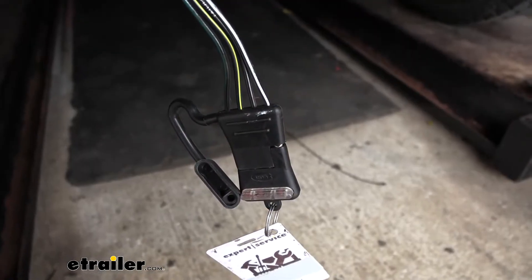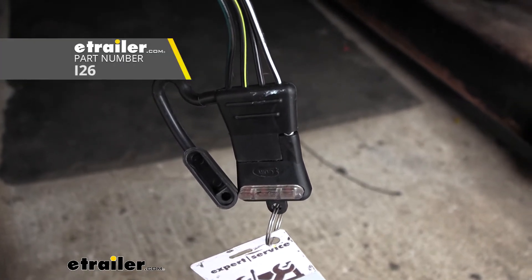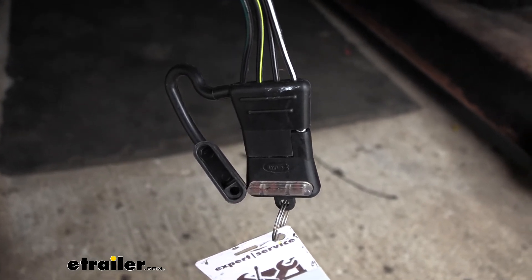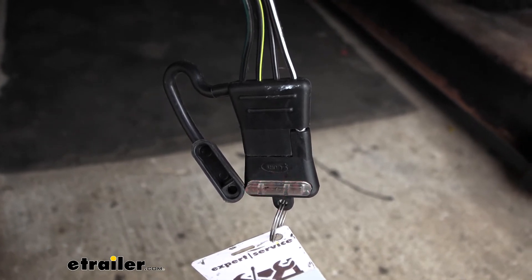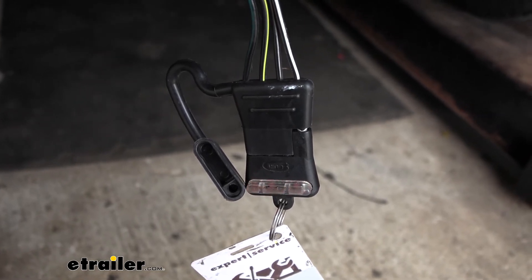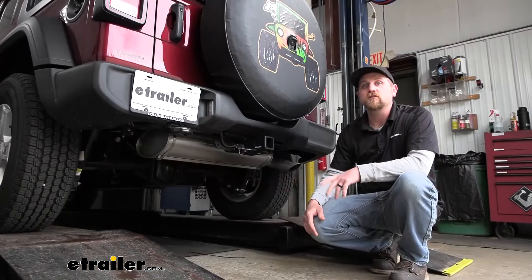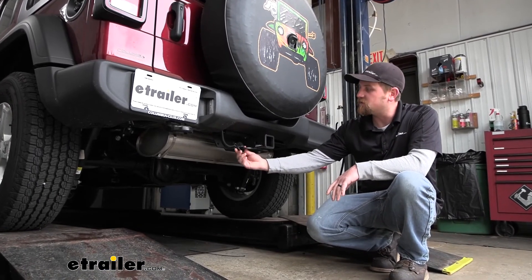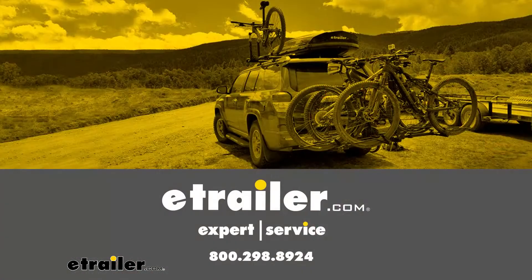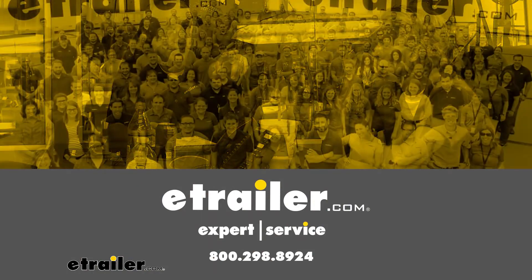That's a good idea to test our wiring to make sure it works properly. I suggest using a tester like this as opposed to just plugging it into your trailer, because if your trailer has issues they'll be translated over the wiring. So we'll go ahead and try our left turn signal, our right turn signal, our brakes, and our running lights. And that'll finish up our look at and our installation of the Tekonsha T1 vehicle wiring harness on our 2022 Jeep Wrangler Unlimited. We'll see you next time — thank you.